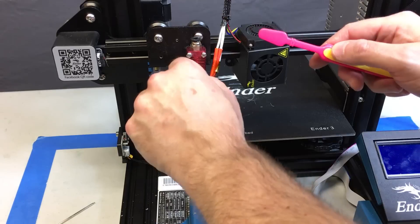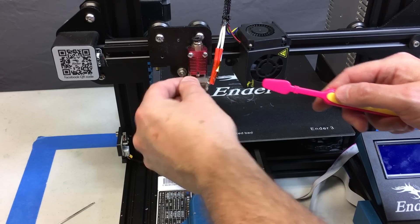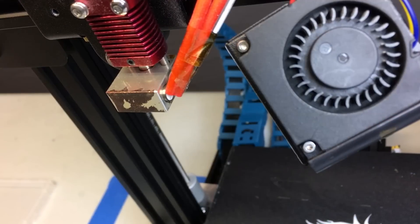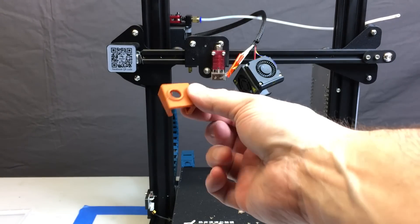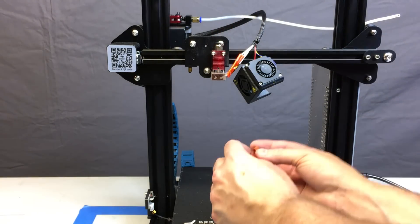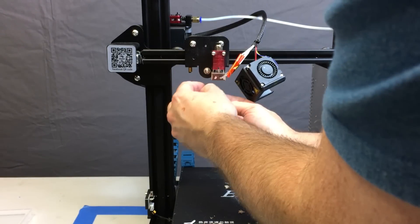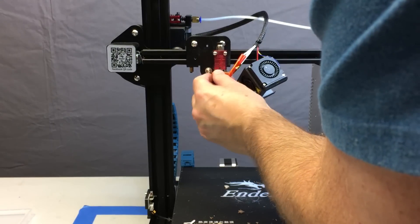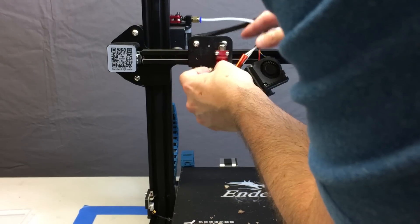I'm going to put a silicone sock on this — it does a little bit better job and it's a cheap upgrade. I've got a link in the description from Amazon. Get all that old insulation cleaned off; that's what your heater block should look like once it's stripped. The silicone sock just slips on over your heater block — no tools needed. The link I have is for one pre-fitted to your specific hot end. It has a little cutout on the side for the wiring. Make sure it fits on there good.